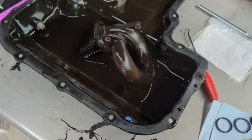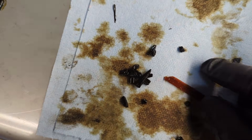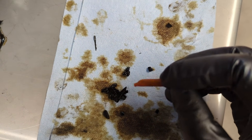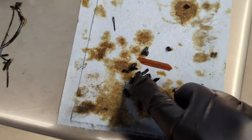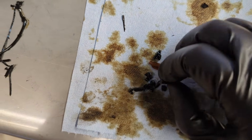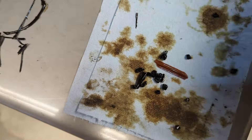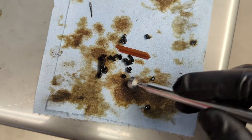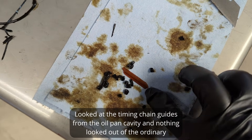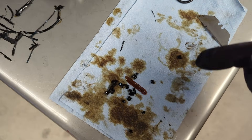While scraping away all the old gasket material to put on new RTV, I found these floating in the pan. This one is more concerning — I think that's a bit of the timing chain guide, given the color. These are all just sitting in the bottom of the pan. It's not magnetic, so I think it's rubber, or possibly hardened RTV — but it's really hard, way harder than the stuff I'm scraping off. I'll take a look at the timing chain guide from the oil pan side to see if anything is obviously missing, but hopefully it's nothing serious. Let me know in the comments if it's something I should worry about.